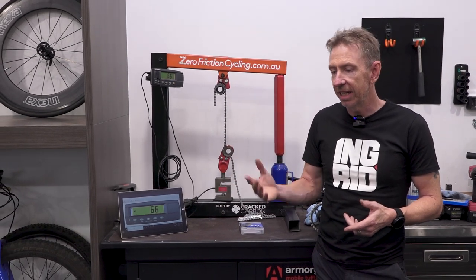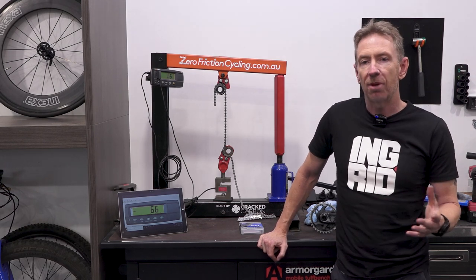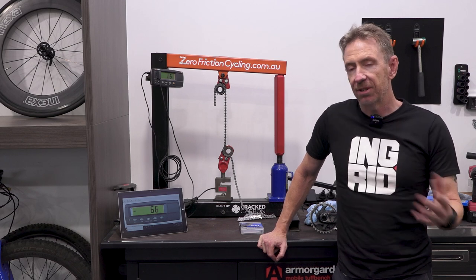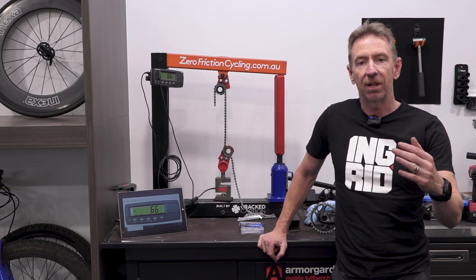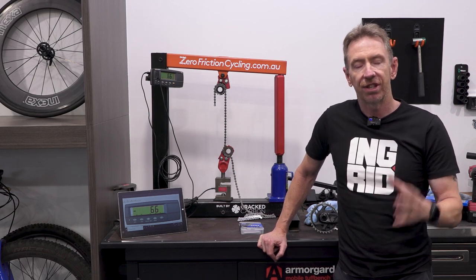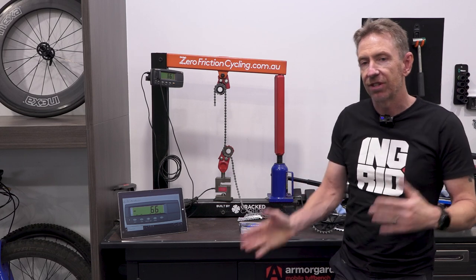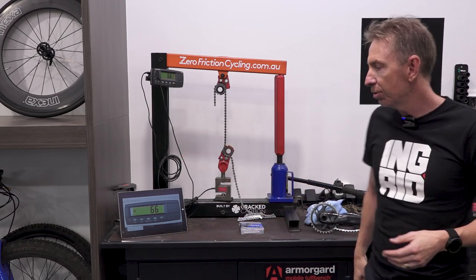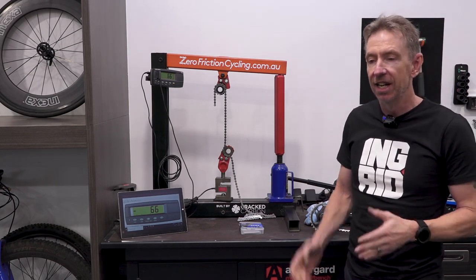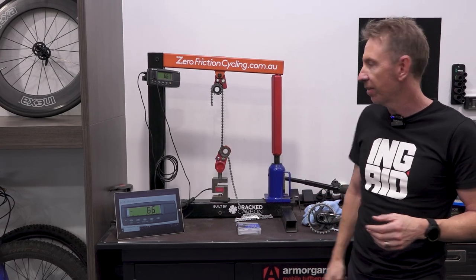That's a fairly large wear case, but it is not that uncommon that people run their chains to over 2% wear. So it does appear that somewhere between a 1% wear mark and about a 2% wear mark, the tensile strength of the chain does start to decrease. Again, how much that factors over to what it's going to be on a chain line angle, not sure, but it was interesting to see that there was a measurable difference once we get to those more extreme wear rates.